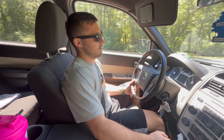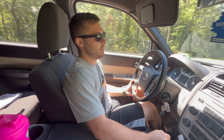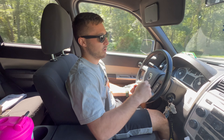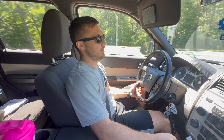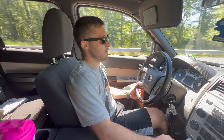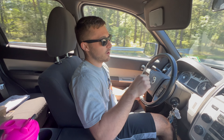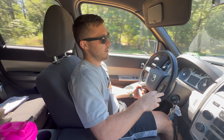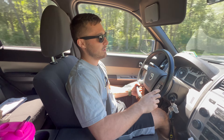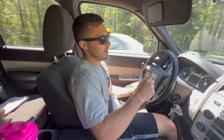...we went to start the truck and it didn't start. We tried jumping it — maybe the batteries were dead — that didn't work. Then we got brand new batteries because the old ones were kind of old; same problem, still wouldn't start. We tried tripping the starter solenoid, that didn't work. We tried popping the clutch — pushing the truck to get enough speed — but we couldn't do it because of where we were. Felt kind of defeated. Then we decided to get a new starter solenoid and a brand new starter, because I really think it's the starter. So right now we're on our way back to the Wawa parking lot to try replacing the solenoid first — hope it's that because it's so much easier to fix, though I really don't think it is.